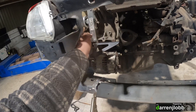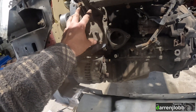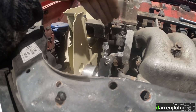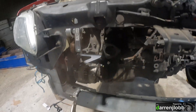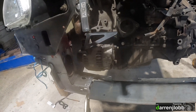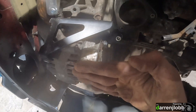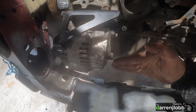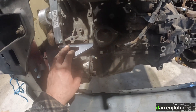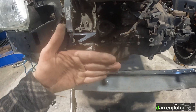There's been a bit of a change of plan. We've got this kit that relocates the alternator down where the air conditioning compressor used to be, because the alternator originally sits there and really protrudes out in the way. The tensioner setup on the OEM setup is up high, which I could make fit but it's going to get very cluttered in that area. With the alternator down there it's out of the way and gives a bit more room up top. The problem is, as you can tell looking down from the top, the alternator now protrudes slightly past where the 306 cross member was. So my original plan of sinking the radiator down behind it definitely isn't going to work, and the thermostat housing has a fitting with a pipe on the front of it which is all getting too close.